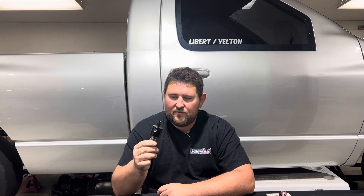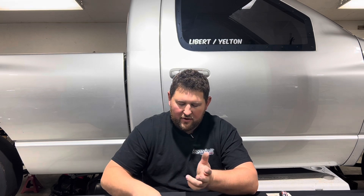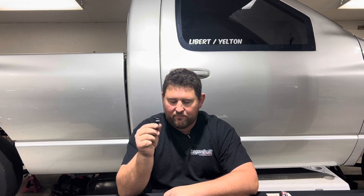A pretty good rundown of nitrous. The only other thing I'll add is that when plumbing this stuff, try to avoid 90-degree fittings as much as possible. It's less important if you're running a single small solenoid, but if you're running multiple stages and using four, five, six, or seven pounds of nitrous per pass it becomes more important. If you need to do a 90, I'd recommend doing a 45 instead if you can. The bigger one is T-fittings — T-fittings really disrupt the flow. If you can, use a Y-fitting instead. If you have a single feed line branching off to two solenoids on each side of the truck, use a Y instead of a T.